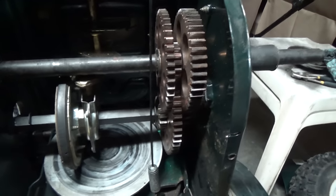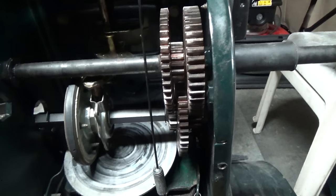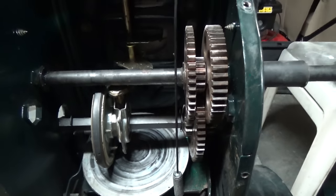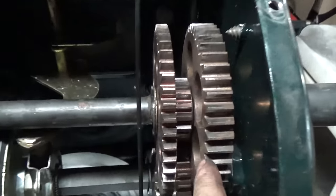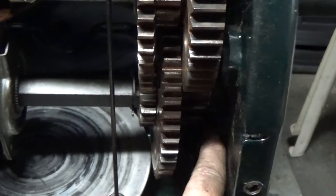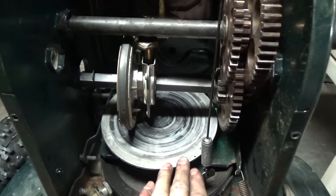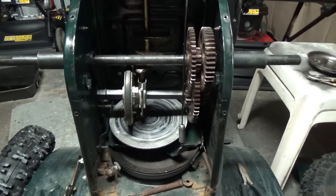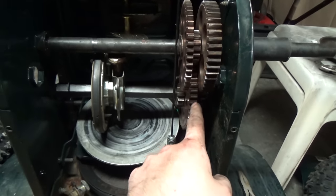This is caused by improper maintenance. You want to be lubricating all of these gears, but if someone goes in and lubricates carelessly you can get oil onto the disc and friction wheel, which you don't want. For preventative maintenance, lubricate right inside and outside of the gear housings and all inside of the shaft areas. Then take some brake cleaner or carb cleaner with a rag and wipe the disc area down. Because there was no preventative maintenance on this machine, we now have a seized bearing on that axle gear.